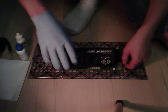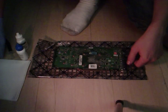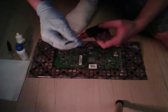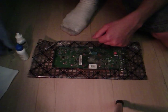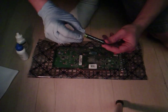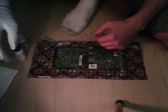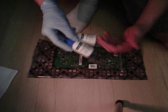To start removing your heat sink on your GPU, you need to flip the card over. The essentials you're going to need for this removal and cleaning are a small Phillips screwdriver, some cloths, thermal compound that you're going to be applying, and alcohol to remove the thermal paste. I actually have a thermal paste remover kit which works really nice by cleaning and polishing the GPU for the new thermal paste, but that's a little overkill.